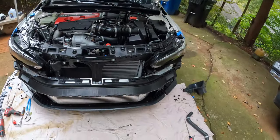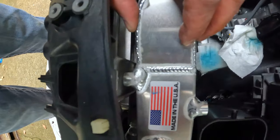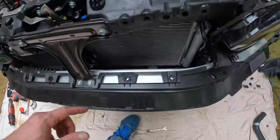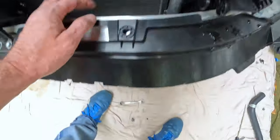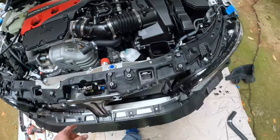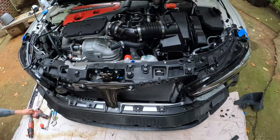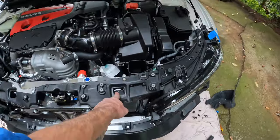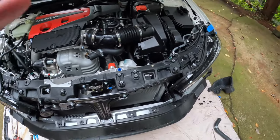Okay, one quick thing of note that we just ran into. This right here is not long enough to accept the factory bolt. I'm gonna have to find some washers probably on both sides here. I did not have any issues down with the bottom ones. Started them by hand and then just used a 10 millimeter wrench to send them home. Either way, coming along, but something important to note, you're probably gonna have to hunt through your used nuts and bolts bin and find yourself a couple of washers so that you don't end up bottoming out inside of here. Not a big deal, but certainly unexpected.